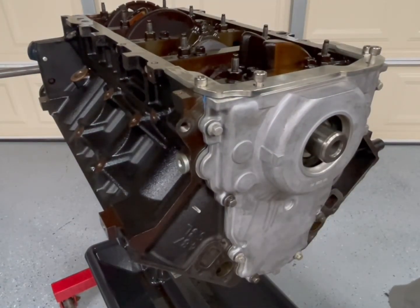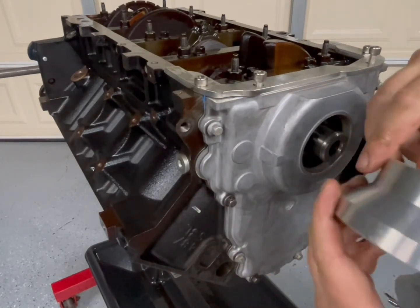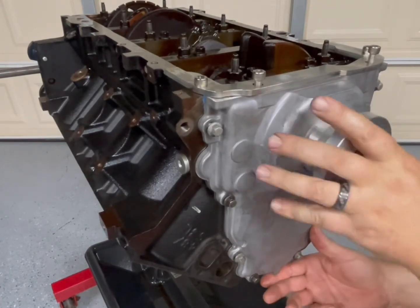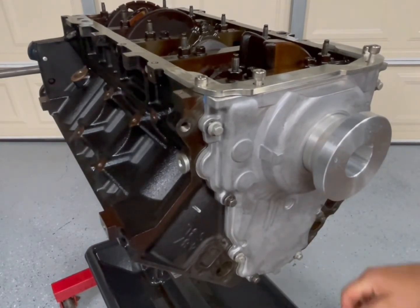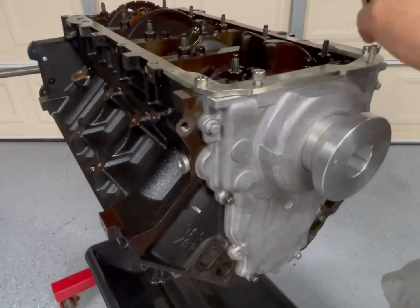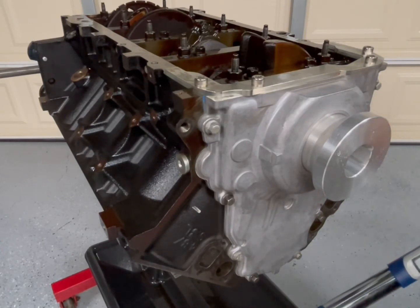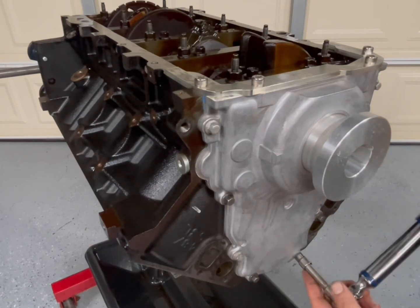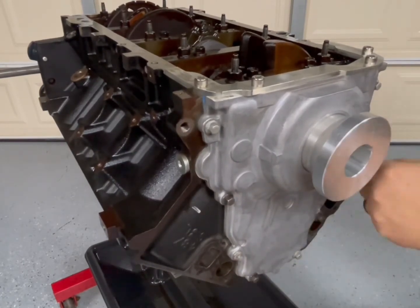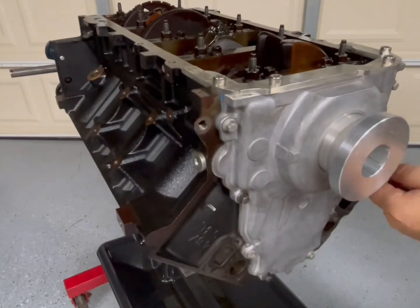Now I take a little bit of assembly lube on my alignment tool. A lot of people don't do this, but I don't like oil leaks. So I'm just gonna wiggle that all in, and now I can run everything down to where it's snug. Then I'm gonna torque it down to nine foot-pounds and then double it to eighteen, crisscross all the way up.